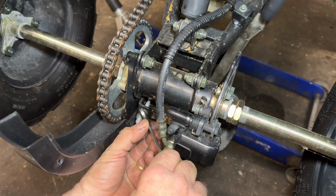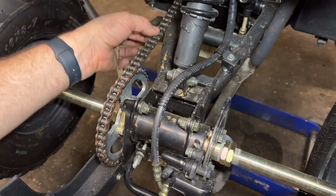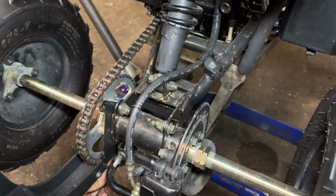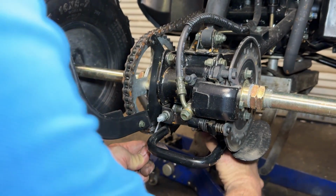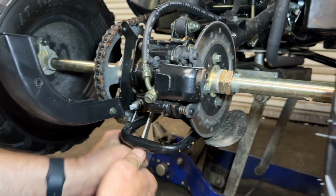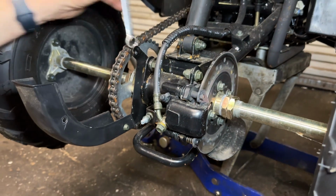And now, the side's already come back a little bit, just because of the way this is hinged. Maybe a little bit more. Okay, there's my half inch of free play. Right there. Now I go ahead and tighten this bolt behind the left-hand adjuster. Double check this one here. I know everything's good. I go ahead and make it nice and tight. And in turn, do my top bolts.